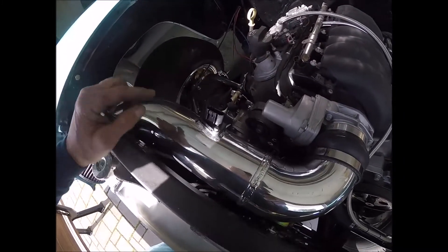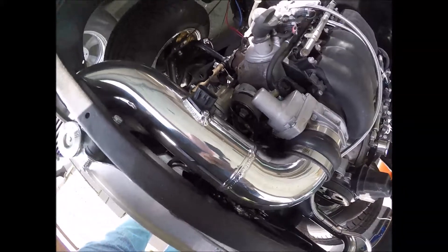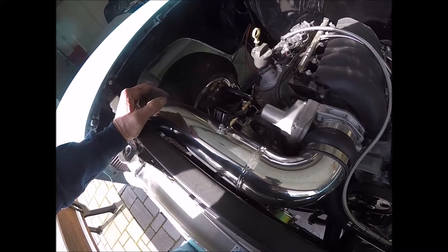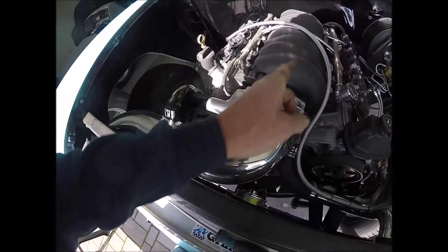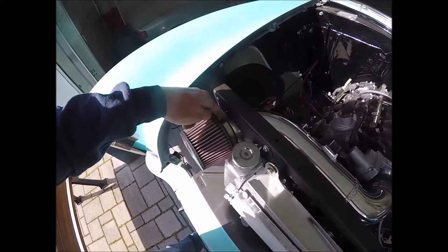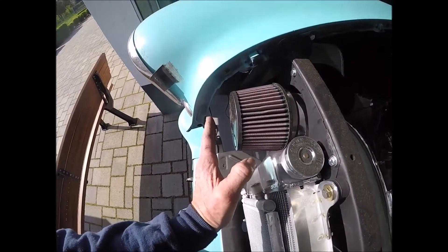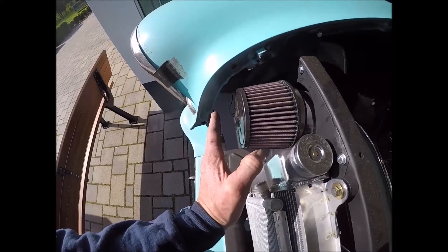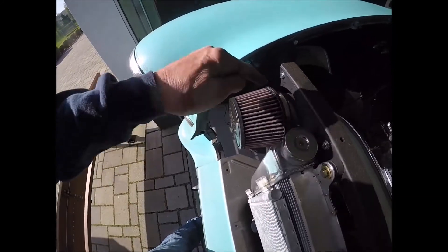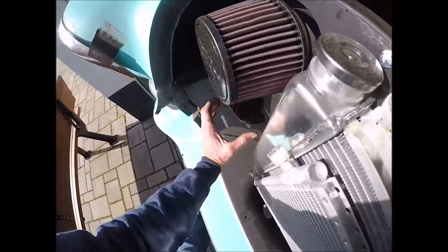Check this out - this is Roland's type of welding right here. Nickels and dimes ladies and gentlemen - that dude can weld aluminum, stainless steel, you name it he'll weld it. Obviously this is the mass airflow sensor and it's directional so it goes this way, comes around the corner. You've got to have six inches over here according to the instructions, and then I basically entered right here with a little K&N air filter - I got the shortest one they had. I might be able to come out two or three inches until the hood closes down.